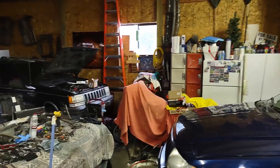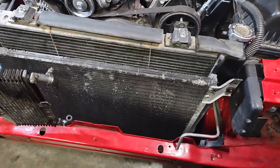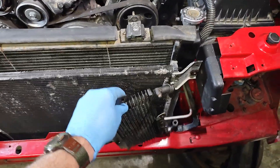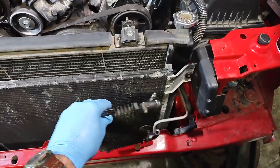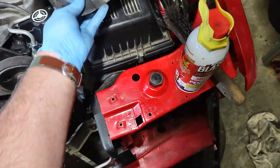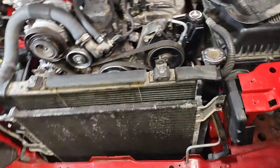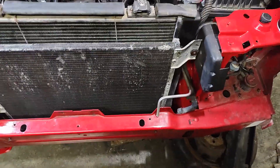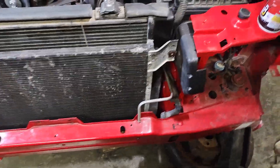What's funny is I just went over and looked at Rokey 2 — his tranny cooler on the V8s is on this side, and the 6s, it's on this side. There's quite a bit of difference. These lines are different — this line comes around the radiator and condenser and comes over here. I wished I would have taken snapshots. This is why it's a good idea — but I had a burn victim vehicle, everything was toast, melted down. It was a disaster. It's always smart to take pictures of something before you disassemble it so you can remember how it goes back together.